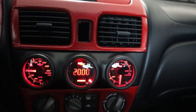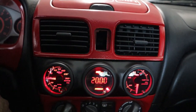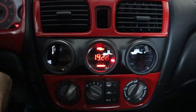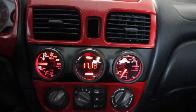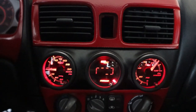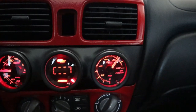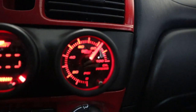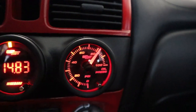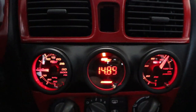I'm going to go ahead and turn on the car so you can see at least two of them in action. The wideband takes a couple of seconds to read because it has to warm up, like every other wideband. There's the oil pressure — and from what I've been learning, they start at high pressure and once they warm up they'll lower.